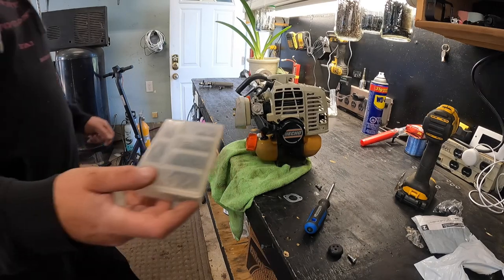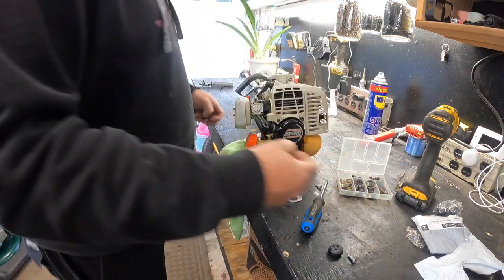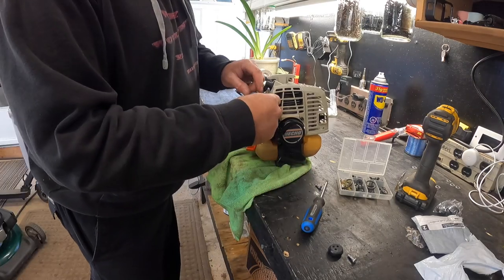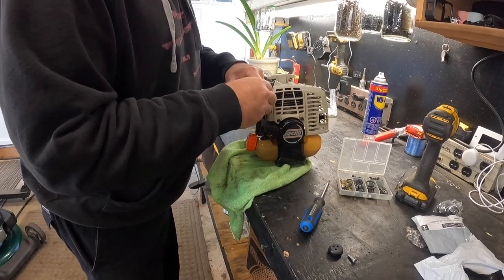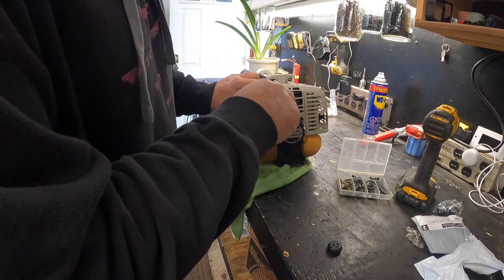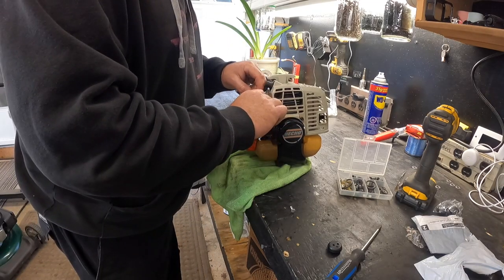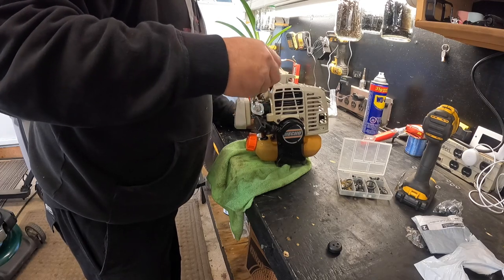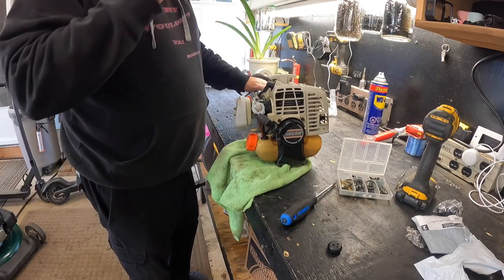When you're getting replacement parts for your Echo machines, make sure you go to the dealer to get the proper parts - don't put monkey brand new parts on it like me. Sure you pay a little bit more but at least you don't have to do what I'm doing right now. I've got a trusty set of o-rings here and I'm hoping by slapping an o-ring on this it's going to create a seal. We'll put that around there, put this back on - that should create a little vacuum seal. There's always a way, even though there might not be sometimes.